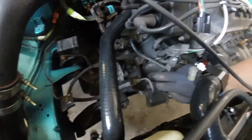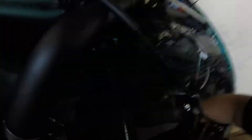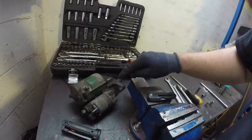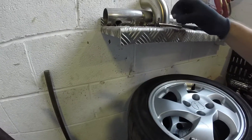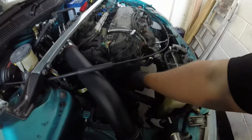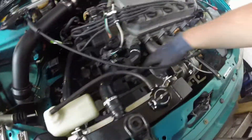I'm going to undo these two bolts here - that'll do my slave cylinder bracket. So this one nut here, these two nuts here, and then undo that power to the starter. The starter motor's off. There's a clip there, this nut there's the power, and there's two 14s - one here and one just underneath. So these are the bolts - one long one, one short one; long one goes at the back, short one goes at the front. All the plugs are off, all the wiring's off. The slave is off - that was two 10mm bolts and two 12s. Still got all the fluid in - I'm not messing with that because it's brand new. So I'm pulling the wire out as well.